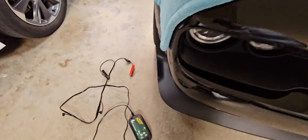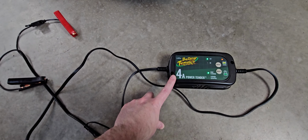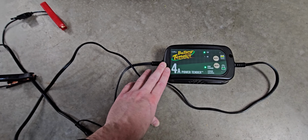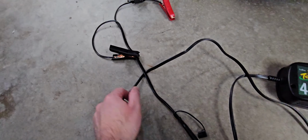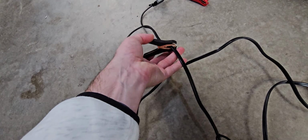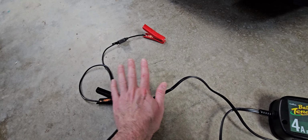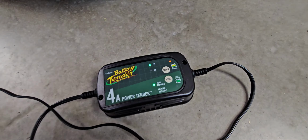And okay, so the trickle charger, link in the description to buy this on Amazon. They also sell it at Walmart, AutoZone, O'Reilly, Advanced Auto Parts, all the auto parts stores, or at least they should. First thing you're going to want to do is clamp back the black negative cable. Don't pinch the sheathing, just put it right in the center there. That's so it doesn't accidentally come in contact with your positive, okay? You don't want that to happen. So we do a clamp back, plug it in, then we do our configuration.